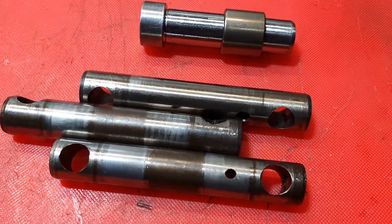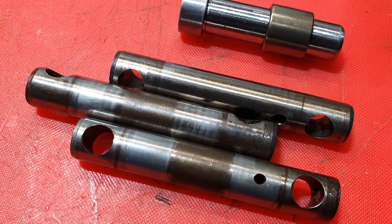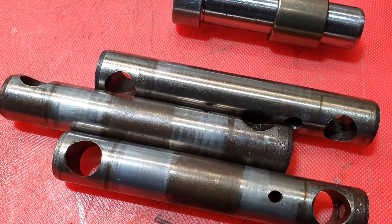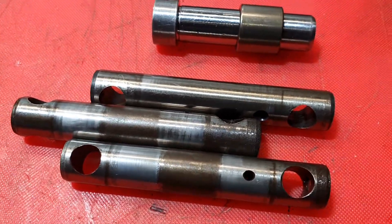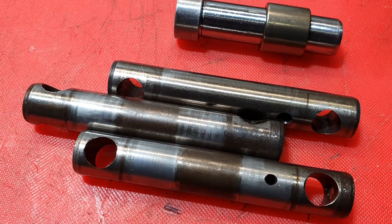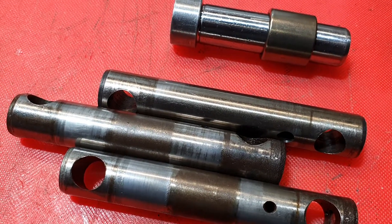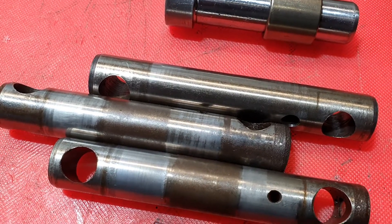It's really important that you read, understand, or watch this video — but get them in the right way. Before putting the engine back together, leave the rocker covers off, earth the plug, spin the engine on the starter motor, and check the oil flow. You should do that at every major service when you take the rocker covers off: get some catch trays, ground the plugs, spin the engine, and make sure there is oil coming out of both rockers on both sides. On the starter motor it should generally flow in a good stream out of the bottom once primed.